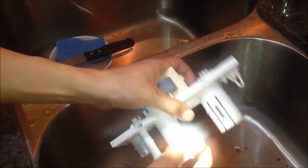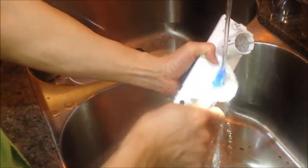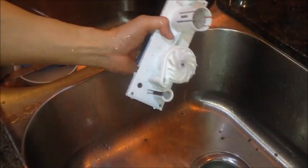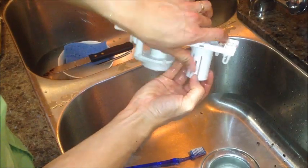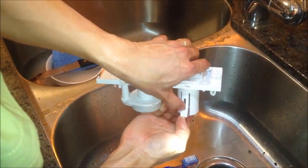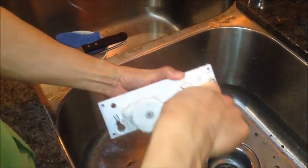I've cleaned this off but found there was still gunk inside here. There are four tabs that you pry back — one, two, three, four — and now you can access inside here. You can use a toothbrush to clean all of this out, though even with a toothbrush it's hard to get that. If you pull these two tabs back, you can actually pull the float out of here. It's got very wide tabs so you have to spread it quite a ways. Now the float is completely out. You have to get in here with the toothbrush and really scrub it clean.